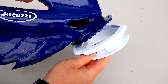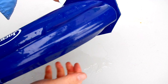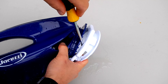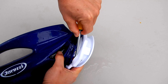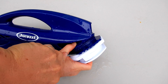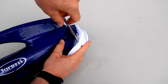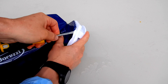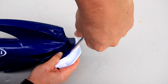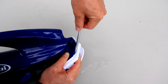I find that it helps a little if you wet the cleaner and the foot pad before sliding it on. Then you'll take a screwdriver and pull the foot pad over the lip of the cleaner like this. Just work your way around the cleaner, using the screwdriver to pull the foot pad up.